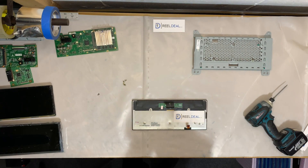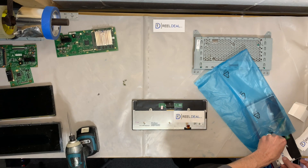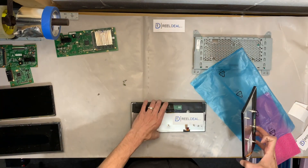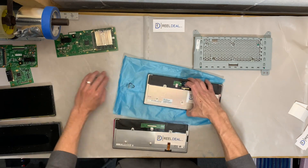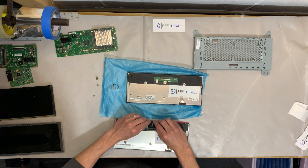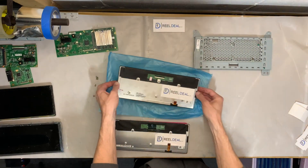This is how you get your new cluster from Real Deal — it'll come in a bag with our logo on it. The only thing you have to do from this point is transfer the ribbon cable from your old screen to your new screen. It's an easy process. You're just going to lift up on these little plastic tabs and pull the ribbon cable straight out, and then vice versa — make sure you get it pushed all the way in on the new one. Pull the little plastic tabs up, slide the ribbon cable in, make sure it's straight, and then push the locking tab down. That's all you've got to do: transfer one to the other.